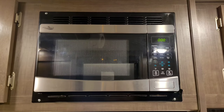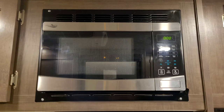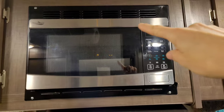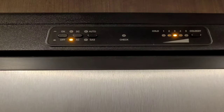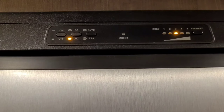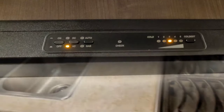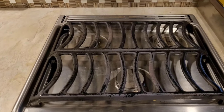We're all hooked up — now let's talk about RV systems and the difference between full hookups and boondocking. One easy way to confirm your electrical hookup is correct: your microwave will be on. When driving without a generator the microwave has no power, so if you see those numbers you know you're hooked up right. Alternatively, look at your three-way fridge — on auto it senses the cheapest power source. While driving it runs on propane, and once hooked up to electric it switches over and you'll see the AC light illuminate.